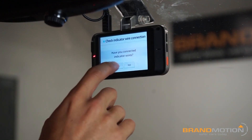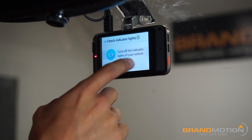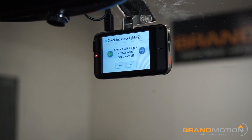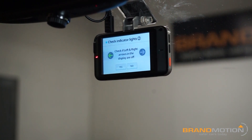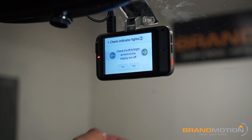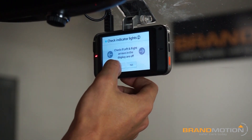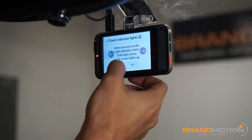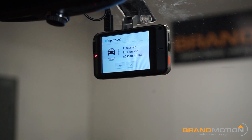Have I connected my indicator wires? I have. So it's going to do a check — it tells me to turn them off. Now we're going to see that the indicators work. I turn on my left blinker — left arrow turns on. Right blinker does the same, so we know we're all good. It recognizes my blinker signals. So we'll go ahead and hit yes. It's going to ask me to check it again — you can just go ahead and hit yes through there. Connection's okay.